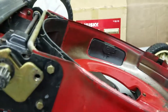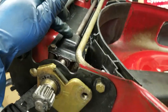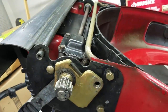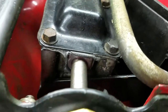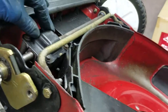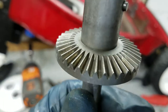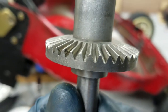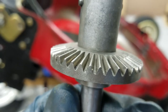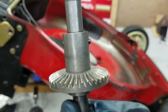That probably wouldn't be too fun just for a belt, but I took it apart and you can service all these one-way clutches. I actually opened up the gearbox and you can see the grease is all dry and kind of nasty. A little bit of water had gotten in it over time, so I put a little bit of RTV all the way around everything including the bushing gear. Obviously you could have a stripped-out gearbox if it just makes noise but doesn't go anywhere - that ring and pinion gear is probably stripped out. When I took mine apart you could tell on the ring gear there was a little bit of a worn groove along the whole thing, which is just indicative of wear. I put new grease and everything in it.